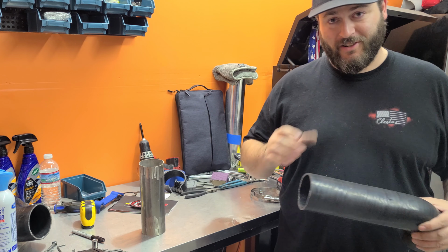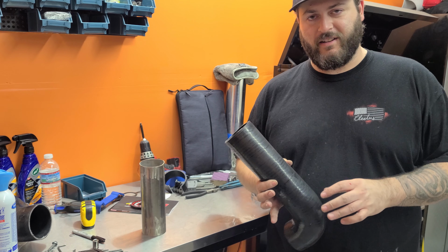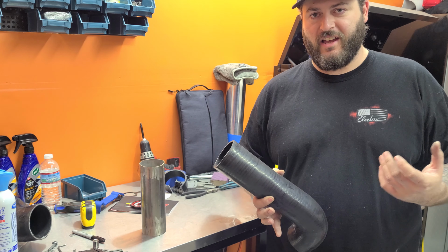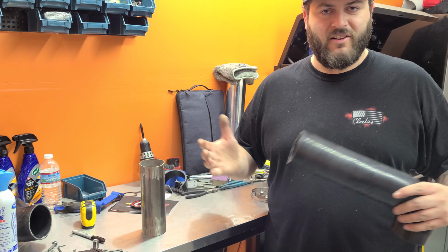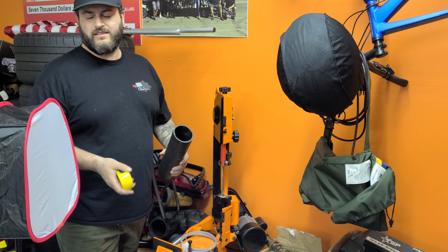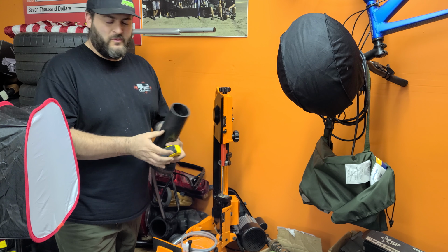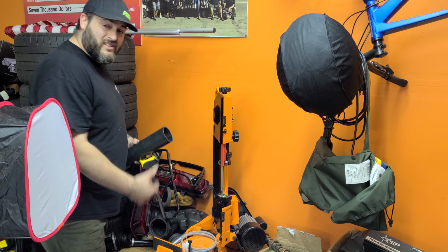So I'm gonna go past that on the bandsaw over there, or I could use a razor, but bandsaw's quicker. And then I'll put the pipe in from the other side, and however much excess I have, I'll put that in the pipe. It's easier that way. It's just how I like to do it. All right, so if we need 5 inches, I'm gonna cut 6, because 6 gives you enough room where you can put a clamp on the pipe so you have an easy way to cut around. So let's cut 6.